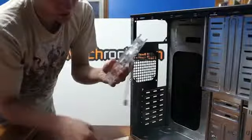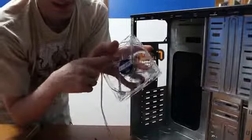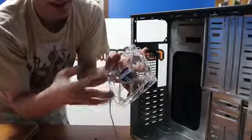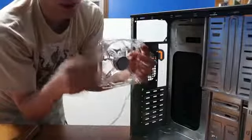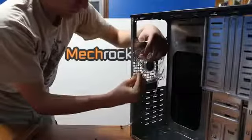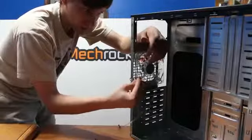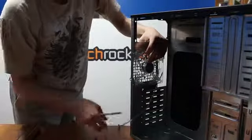What you have to make sure is that the fans are blowing in the right direction. The side that looks like the non-clean, non-professional side is where the air blows out. The air comes in through the suction side and blows out the other way. You typically want the air blowing out the back of your case with a computer like this.